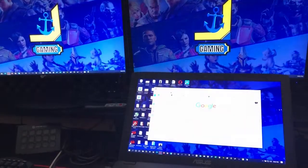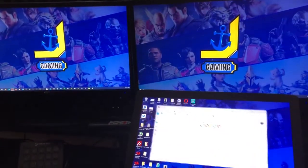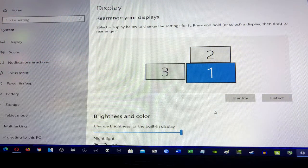This is only dual, so only two HDMI monitors can be linked up with your laptop or PC. And this is for extension, not mirroring — though I think you can still do a mirroring option. A lot of people want the extension option where you can display different things on different monitors. You can adjust the display layout by right-clicking and going to Display Settings to configure which screen is number one, two, or three.